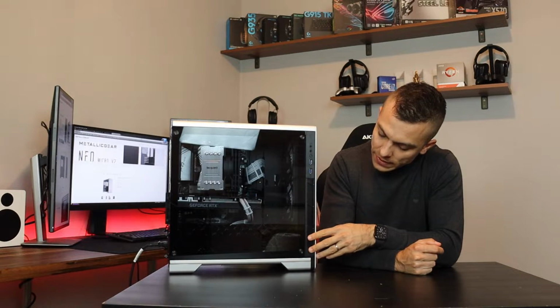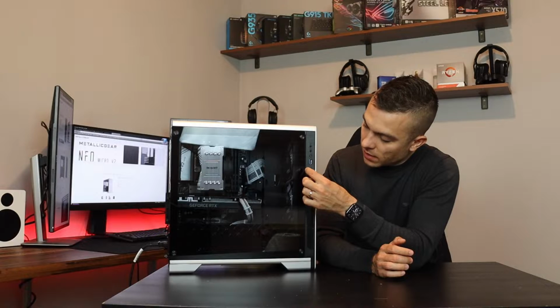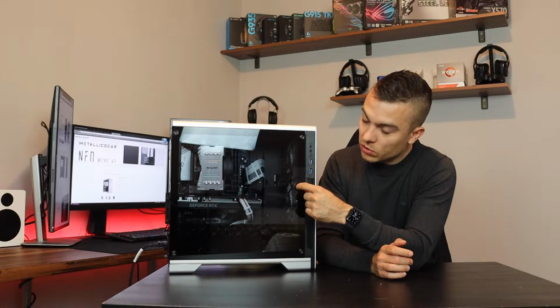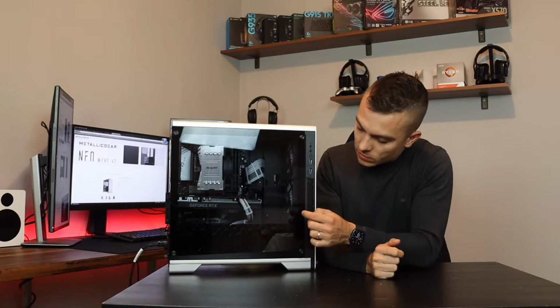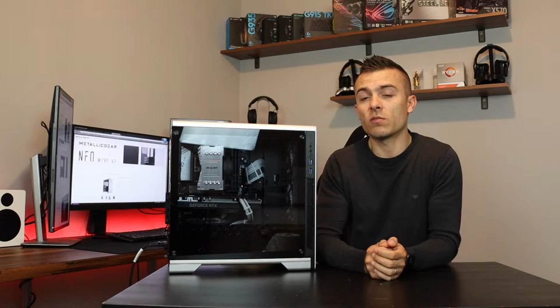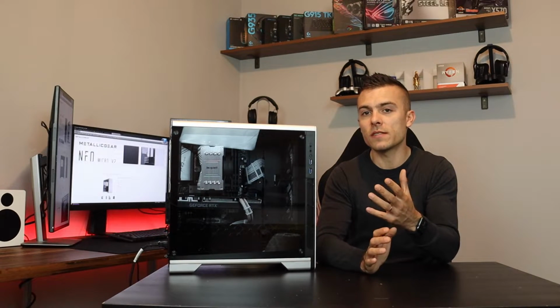Now, going right beneath that you have an opening for your fans and the whole backside as well, which gives the fans enough space for nice airflow, because the fans start right here, 2.5 centimeters apart from that. Now, when you're placing that 240mm radiator on the front, you don't need to remove any hard drive cage or anything, because the radiator almost sits on the power supply shroud. So there you go, you don't have to lose space for your hard drives, you don't have to remove any panels on the power supply shroud, you just place the AIO radiator on the hinges for the fans.